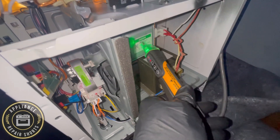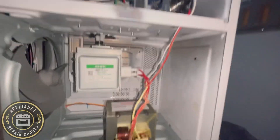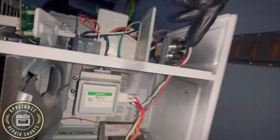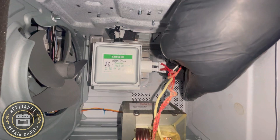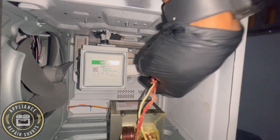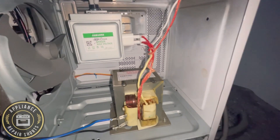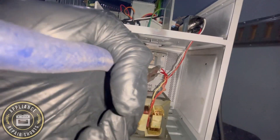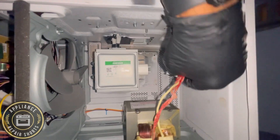We're going to pull this out and check it — I'm going to check the resistance and see what the reading is. We talked about discharging the capacitor. Let's say you're not comfortable doing it — you don't want to. You see that neutral and where it goes. To be honest, if you don't touch up there and concentrate here — don't touch any wire, this is bare. If you can wear rubber gloves, even better. They do protect. But if you're not totally confident, you can always get a pliers, squeeze it, and just take it off. It's plastic, everything's insulated here — pretty safe. But just in case, if you're not totally confident, you can do that.